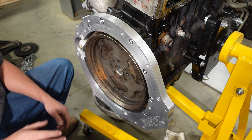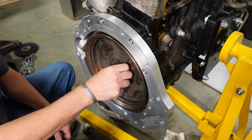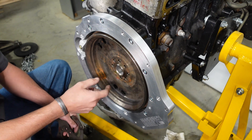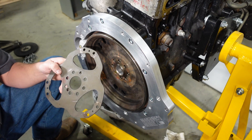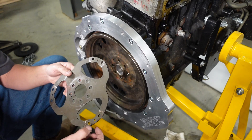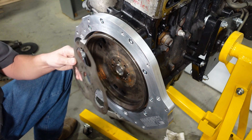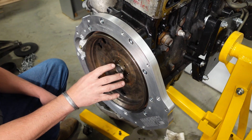Next, we'll move on to the crankshaft adapter. For the manual transmission crankshaft adapter, start by taking out the flex plate bolts. In this example, I'm removing the flex plate but leaving the flywheel — this is the NA-606 version, which actually has a flywheel with a ring gear on the outside. For a turbo 606 or some other engines, there are two flex plates stacked with a ring gear and riveted together with a flex plate washer on top. In that case, take the washer off and put the flex plate back on. Then clean the mating surface.